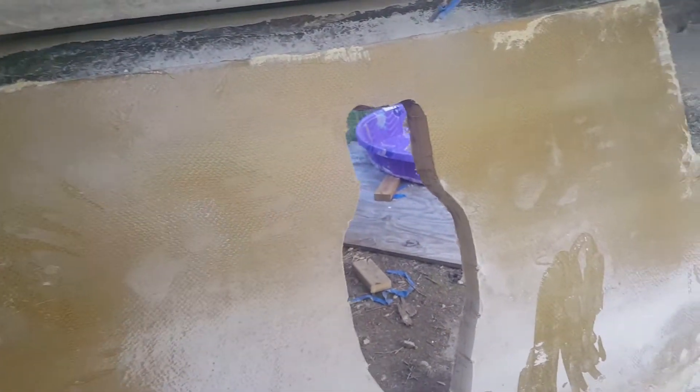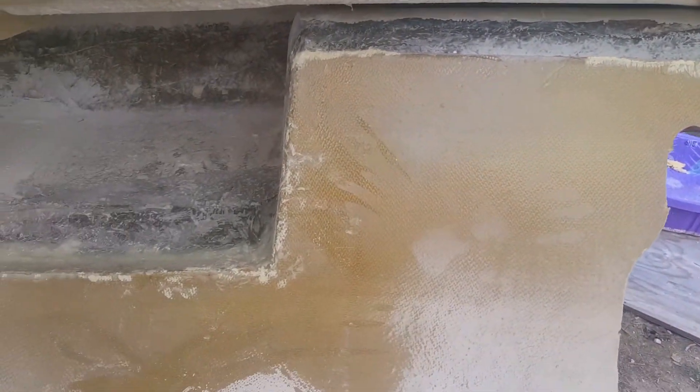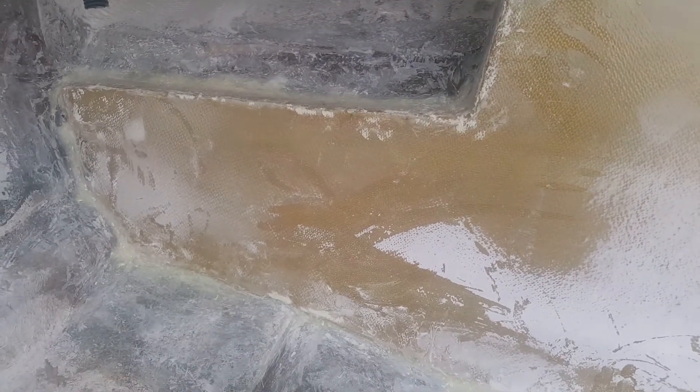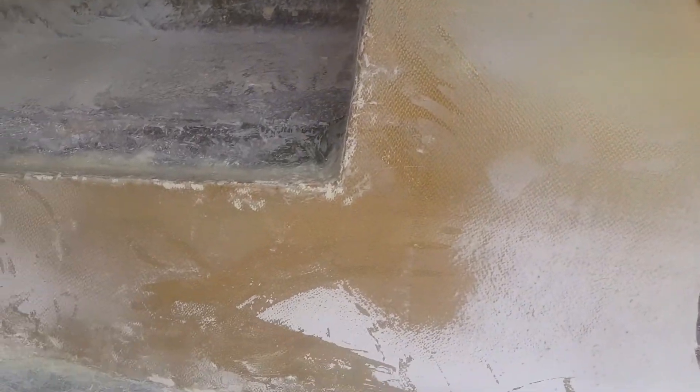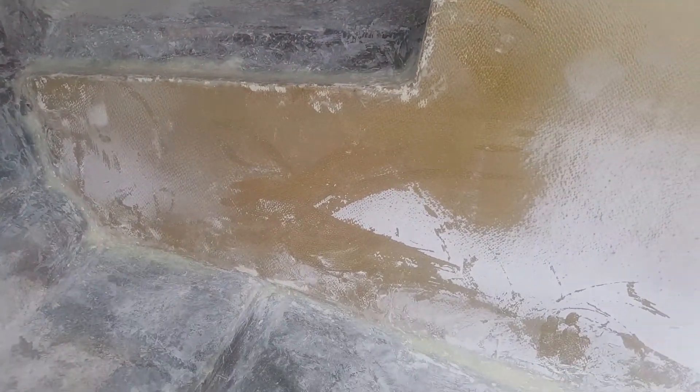What I'm going to do now is go take out the six-inch Kevlar and get that ready. I'm also going to clean up this area. You can use a shop vac to vacuum some of the excess off, and then you want to use a de-waxer — because the grinding wheel has a wax coating on it — and you want to get all that excess out so you get a good adhesive bond between the Kevlar and the epoxy resin.